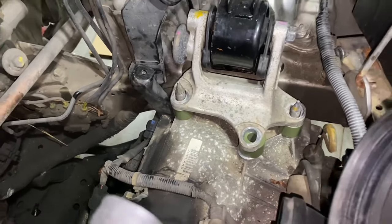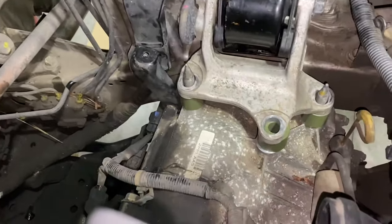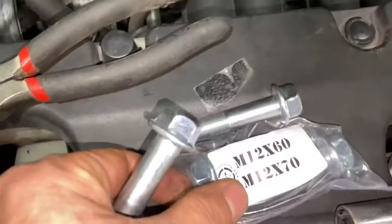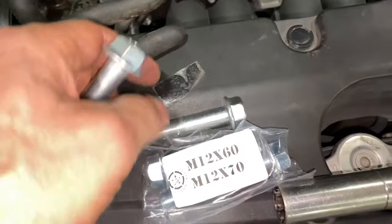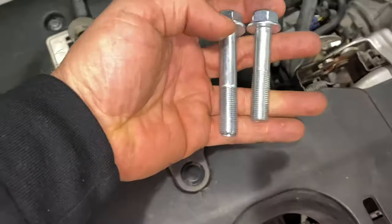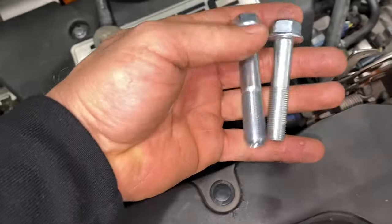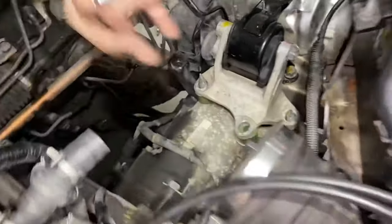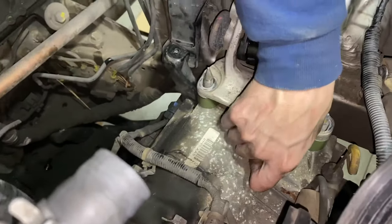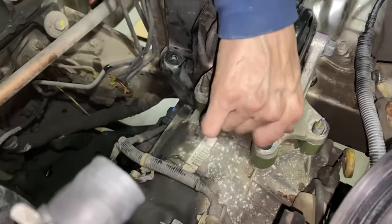There's one bolt right here that comes with the kit — you're going to take out the factory one. That's going to take an M12 by 70 and it comes in this little pack right here. If you just open everything up, dump it out, and throw away the instructions, you'll want to grab the longer of those two: this is a 60 and that's a 70. The 60 goes over here and the 70 goes on that side. Drop that in there and tighten everything up — that side is pretty much done, just put the air box back in.